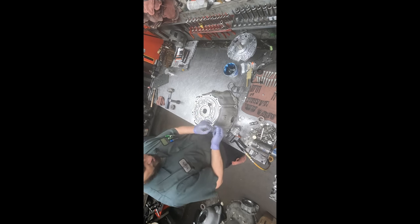No gasket, all the sealing is done back here. Now on a two-wheel drive unit, these two holes here are gonna be open for lubrication back to the splines where the slip yoke goes on and a bushing back here that needs that lubrication. On the four-wheel drive, it's open back here, and so they plug these off. There's nothing really there that needs any significant amount of lubrication beyond maybe a light coat of grease on the splines.